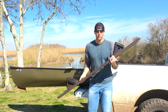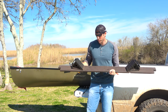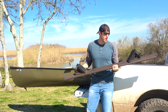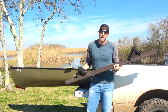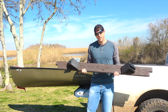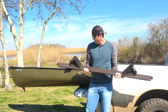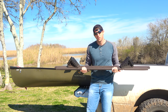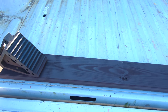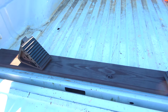So we went and made this bad boy. What this is — it's a deck board that I had, and I got these two rubber tire chocks. You can get these from Harbor Freight for about six bucks, or from Tractor Supply for about $15 to $18. We'll put a couple of links in the description below. This was actually pretty simple — I took this deck board, cut it to length for the width of the back of the truck bed, and notched it out where it fits just inside the truck bed where the lights are, so it can't slide out.